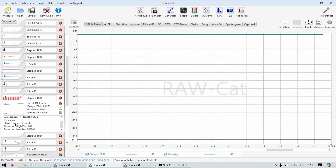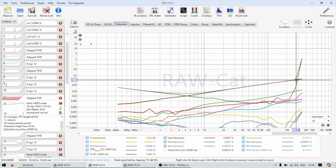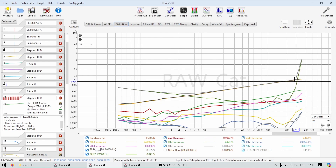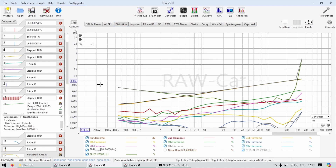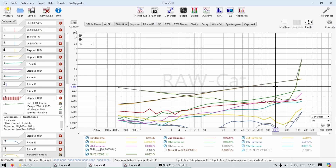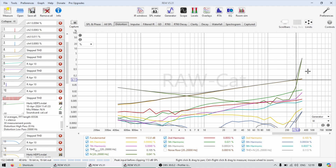This is a five-channel amplifier, and here is the subwoofer channel. Surprisingly, I only got 320 watts at one percent THD — it's rated at 550 watts at 14.4V, so I'd expect at least 400. It's a bit less, but fine — we still have close to 300 watts super clean at 0.1, which for a subwoofer is perfectly fine. The subwoofer is a 500-watt rated driver in an oversized sealed enclosure acting close to infinite baffle, so 100 to 200 watts is plenty enough.